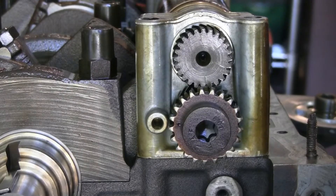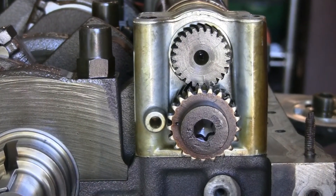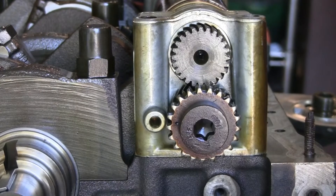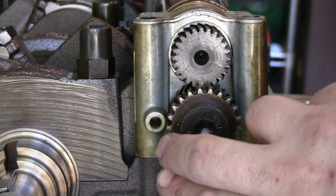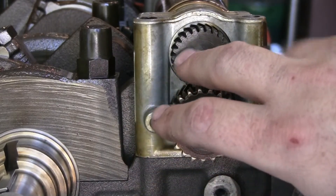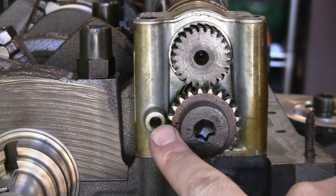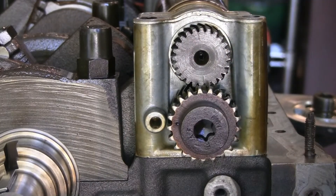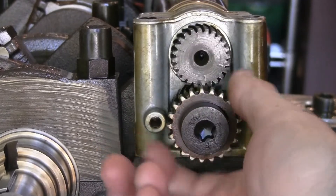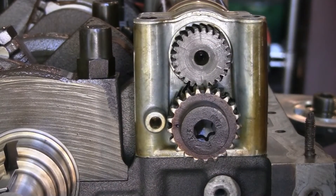This particular one has a single dot and a bunch of lines on the gear, but you can't time the shaft to the crankshaft with just these marks — that's really the source of confusion. For those curious, this is a genuine Ford balance shaft, part number 8L2E6A311-AA. Instead of having two marks to line up with a hole and another mark with the bearing split, this shaft only has one mark and six marks on the gear. There are six identical marks, and no matter how much you turn the shaft, when the dot lines up with the hole, a line lines up with the bottom of the gear with no opposing mark.